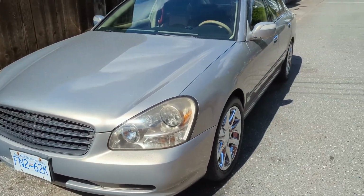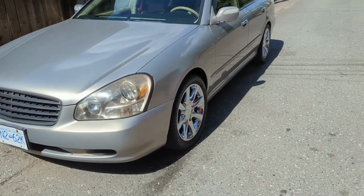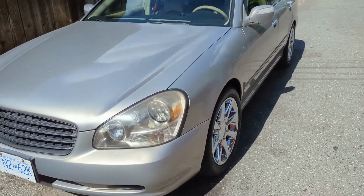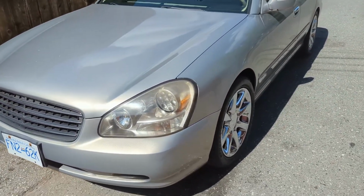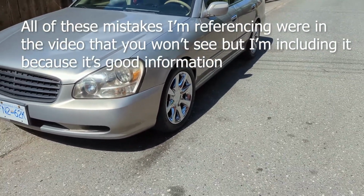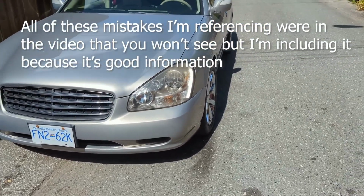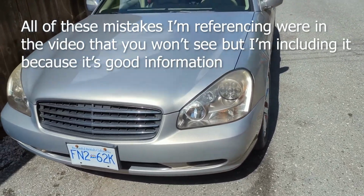If you have a more powerful coil pack, then it should be able to power a bigger gap. You shouldn't have to go down in gap. All the people online saying you have to go down for the R8 coil packs are on forced induction setups. Realistically, the stock gap and the stock heat range is the correct plug.